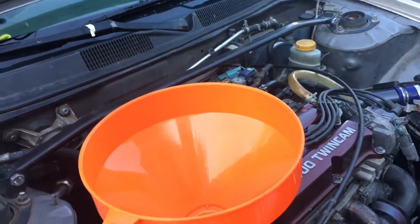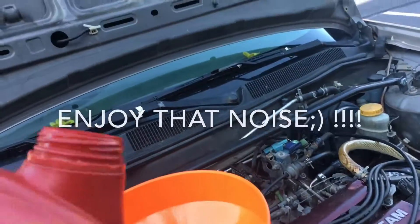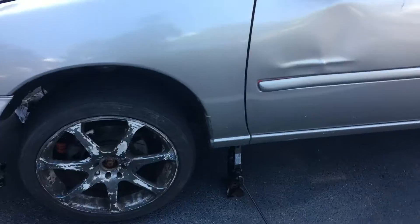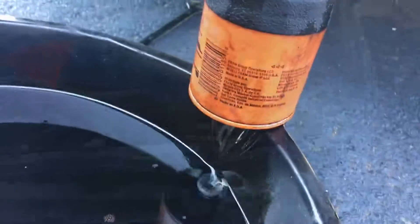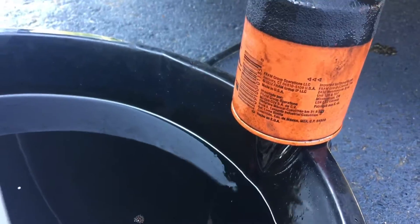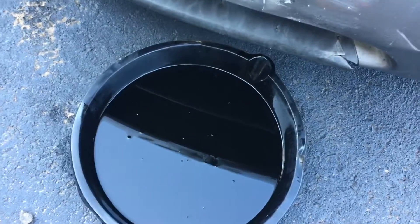I'm about to fill this thing — this might be the first time I've ever used a funnel to pour oil. It's a 4-quart oil change, usually with a half-quart extra if you fill the filter, which you always do. After that, take your car off the jacks, make sure everything is tightened up. Let your car sit for about a minute, check the oil dipstick. You can also tilt the drain side of your oil pan to drain out any remaining oil in the filter. Drop your old filter in the box and get ready to dispose of that oil.